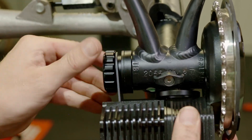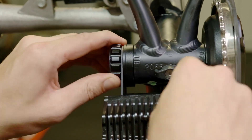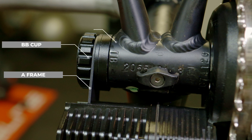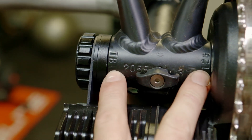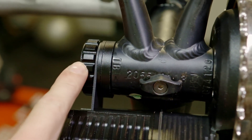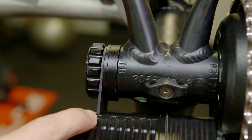Please be reminded to add grease to the threads to help with threading under high torque. Tighten by hand at first. Please take note that the A-frame support structure for the motor always needs to be included in between the BB cup and the non-drive side BB shell, to add up to the correct spacing as well as provide support for the motor itself. Next, you will see that we have the 73 millimeter bottom bracket, plus a 3 millimeter spacer, plus a 7 millimeter spacer, and the A-frame support, then the BB cup.